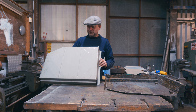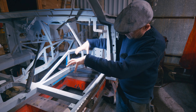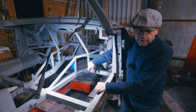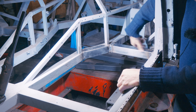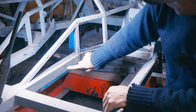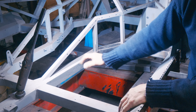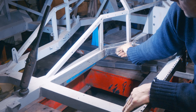They'll be saying that's mad Mark's work too. Okay, here's our chassis and what I'm talking about when it sort of steps down into it. I've let a new piece of chassis in here because that was very peppered. One of the pitfalls is that damp gets up between here and rots these out.